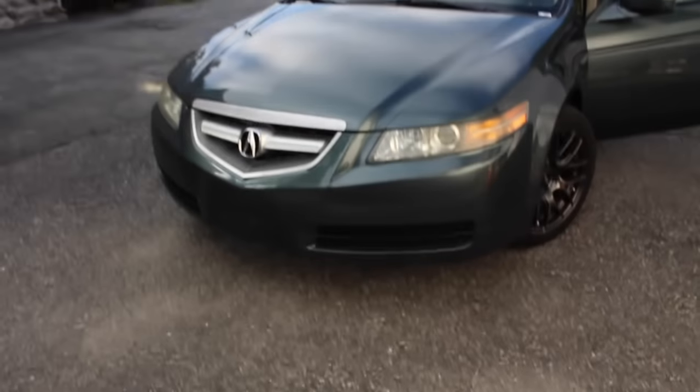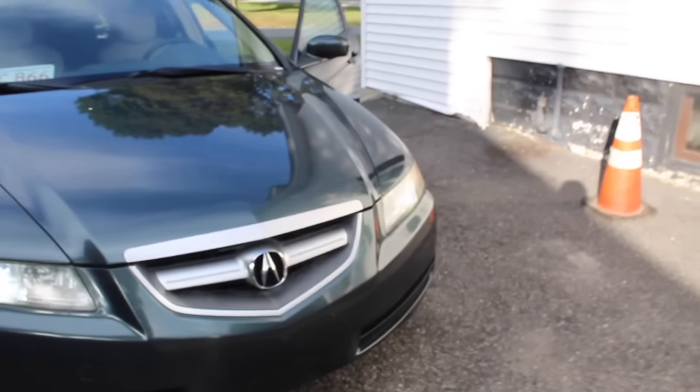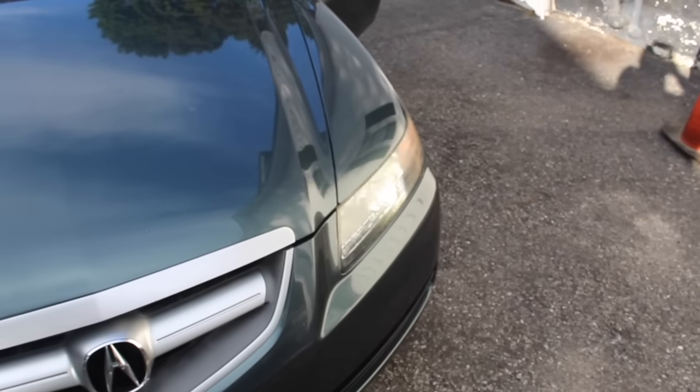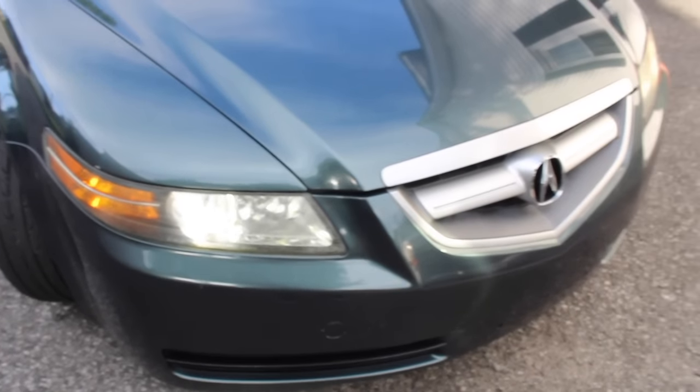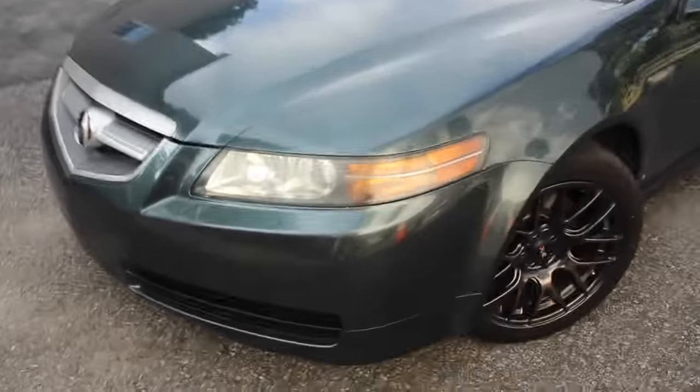The sun's going down. I'm going to put my car back together and take it for a spin. The bumper's all put back together — let's turn it on and check it out. That's the one that was working before — there we go, that's awesome. As you probably know, these bulbs are like $100 at AutoZone each, so I went on Amazon and bought a couple for $25. I'm really happy that I figured it out and it actually was the ballast or the igniter — I just replaced them both. The only hard part was accessing the ballast, which happened to be under the headlight, so I had to take off the bumper and everything.